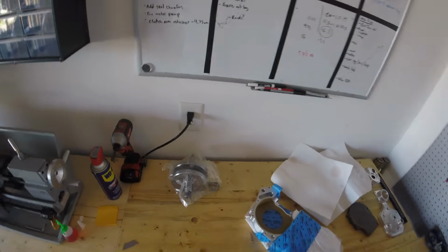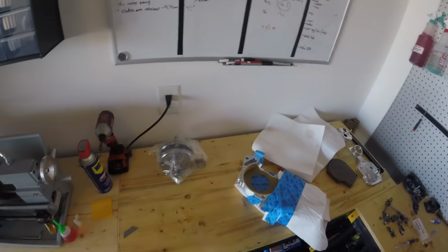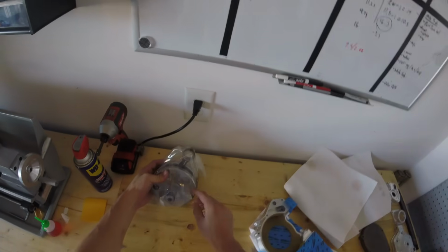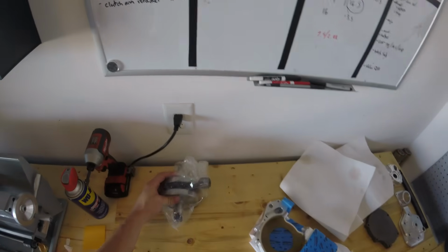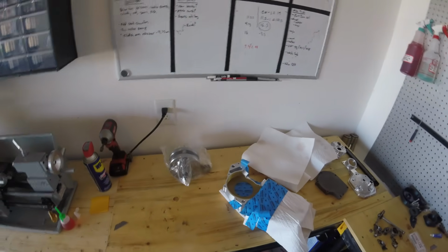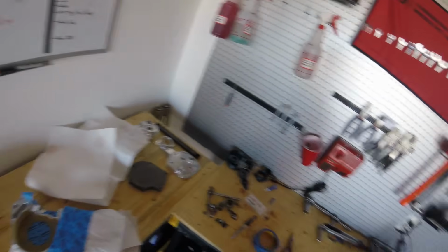This rod, I liked the length of it. It fit the engine nicely. And Brian did a fantastic job on this. As you could also see, it's not unboxed yet, but these circles here are tungsten counterweights, which I designed around a 58% balance factor, and Brian machined those and installed them and got everything perfect. So very happy with that.